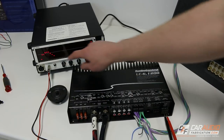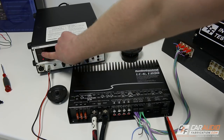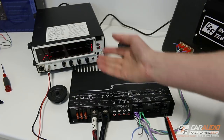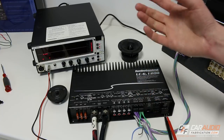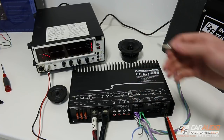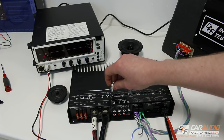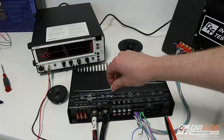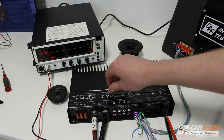There's still one more issue with this signal — we don't have quite as much bass as would be great to send to a subwoofer. That's because the car manufacturers like to limit the bass. But not to worry — we can use AudioControl's AccuBass technology. The level is all the way down right now, but if we start to bring it up, you can see we're bringing in a lot more of the lower region and restoring that bass.